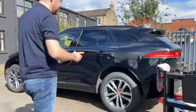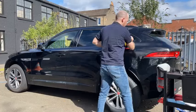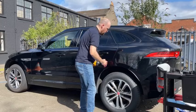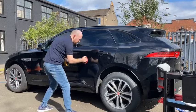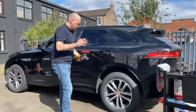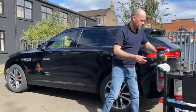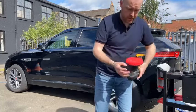What I'm going to do now is take some of that hand-applied product and put it onto the pad to show you how much product should actually be on the paint. With machine application you can barely see it — almost like a hologram is what you're looking for. Whereas on the hand-applied section you can see the buildup — a huge amount of product there. That's why I apply it either via machine or via foam pad applicator.